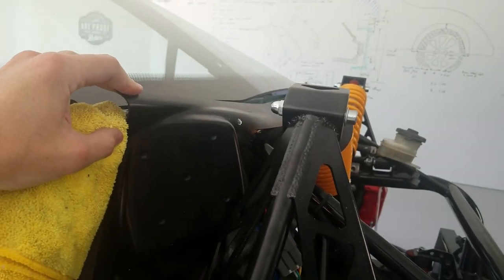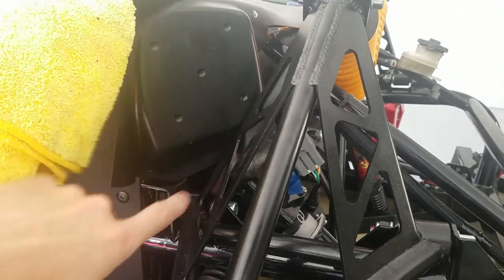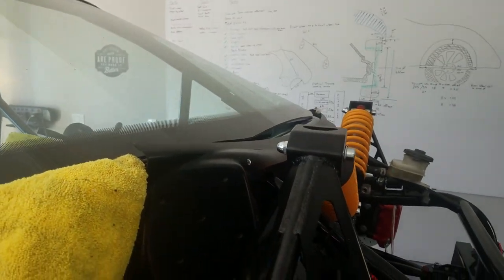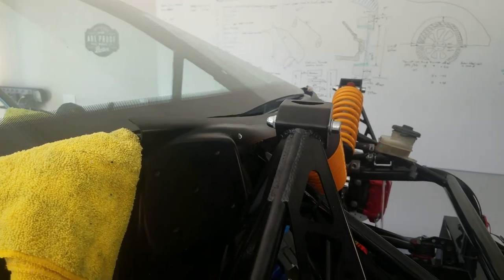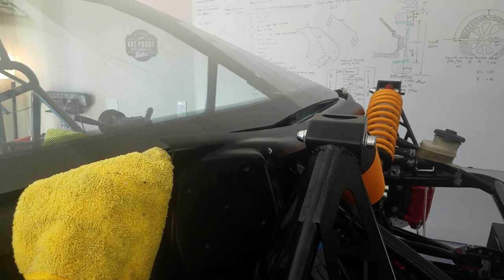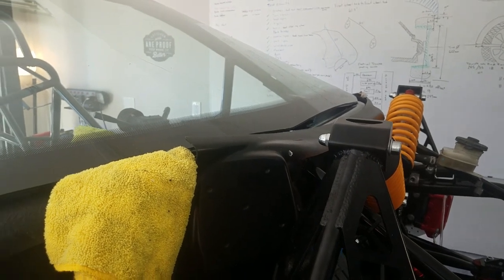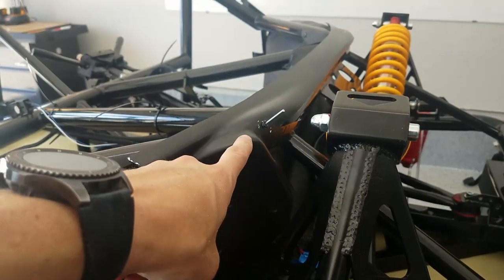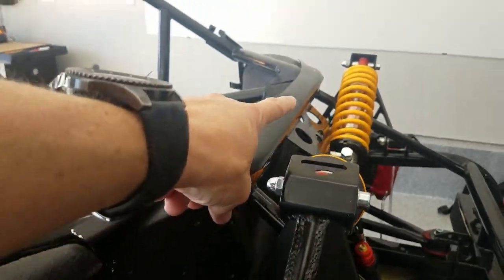So I'll go ahead and section this off, drill all the holes for rivets, put the adhesive on, the sealant adhesive, and get that part fitted, and we'll go from there. Cut that off. I'm going to start drilling and riveting all across here and go from there.